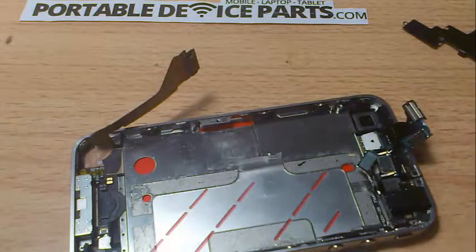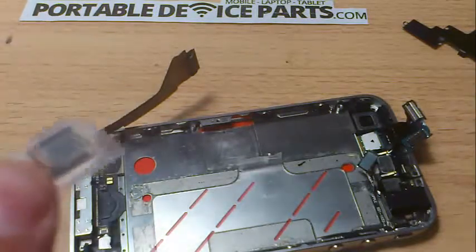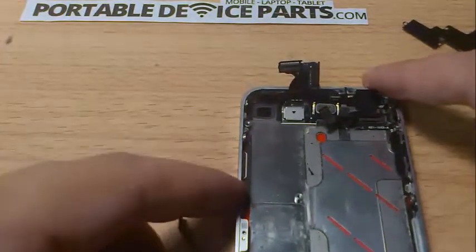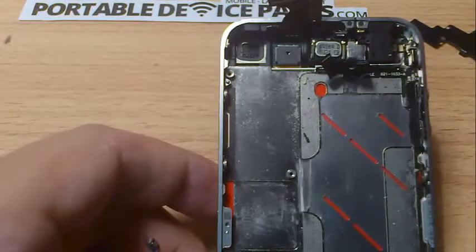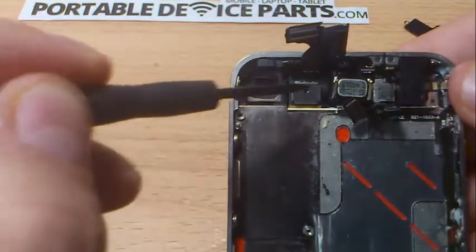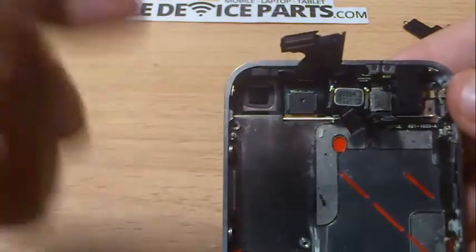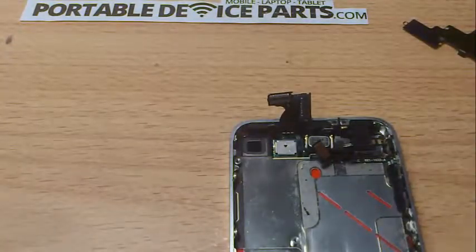This is a spare one I have lying around — they come in packs like this, protected with toolkits, and look exactly the same. Now this is the most important thing to remember: turn the iPhone so the top is pointing north. You will see two little wires — they need to be pointing up like that. Generally there'll be text on it, so the text should be readable and not upside down. Just get that right and you should be fine from here.